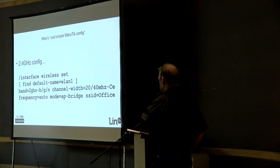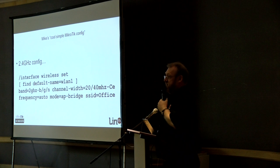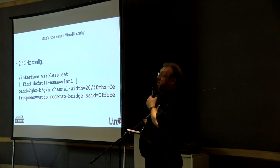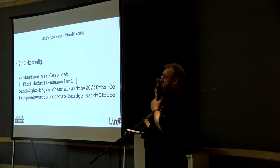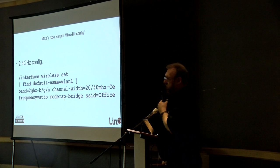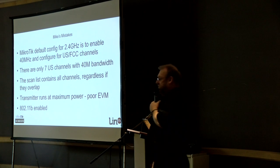Out of the box it's also running 802.11b. We don't like B anymore. If in your office you're really saying someone's going to walk in with a device that only supports 802.11b — be afraid, be very afraid. We don't need to support it. If you're running a warehouse with barcode scanners from the 1980s on B-only chipsets, then fine — deploy access points supporting B. But if you're trying to support office workers with iPhones, tablets, laptops — no. Not running B on 2.4. That's what happens when you make assumptions and trust that the default config is fine for you — it won't be.